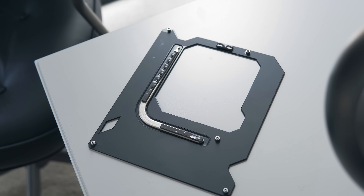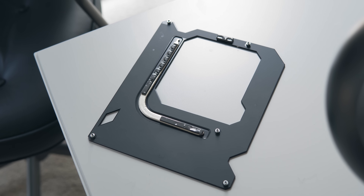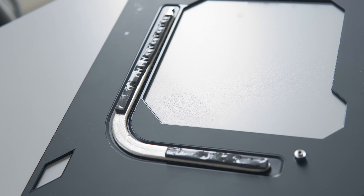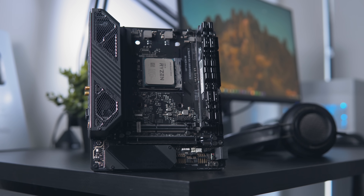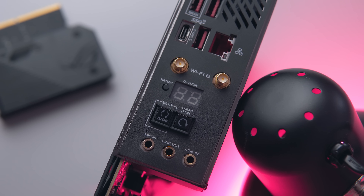What's interesting here is that there's actually a substantial heat pipe underneath. It makes contact via thermal pads to the back side of the Vcore VRM — one of the hottest areas on any motherboard — and the heat pipe also swoops around to the back of the PCIe 4.0 x16 slot. This is something you don't see on many motherboards today, but it does definitely help and it is appreciated.